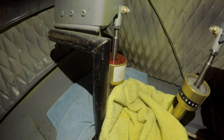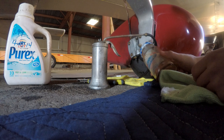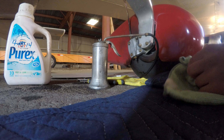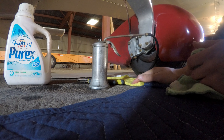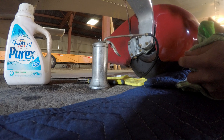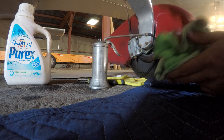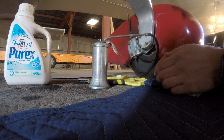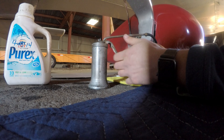Up top again — as you can probably see, it has overfilled the top of the cylinder, so I'm going to drain a little bit out and we should be in pretty good shape. The original plan was to drain a little into a jar, but that's not going to work — nothing low-profile enough — so I'm just going to let a little bit out onto this rag. Anytime I use rags that have hydrocarbons or oil on them, I just throw them out. It's still just hand-tight right now; I'll just let a little run out, then tighten it up nice with the channel locks, put the rubber end back on, and we should be good.